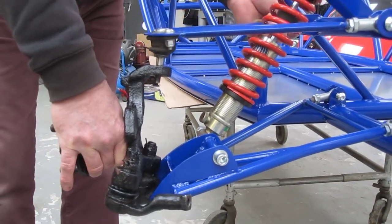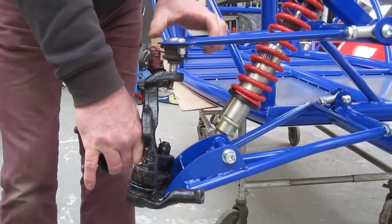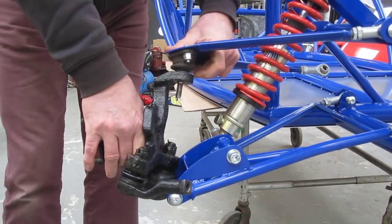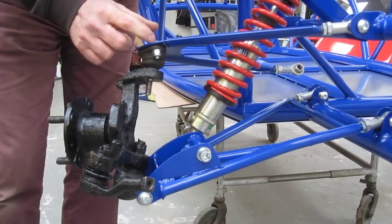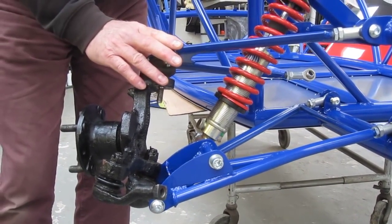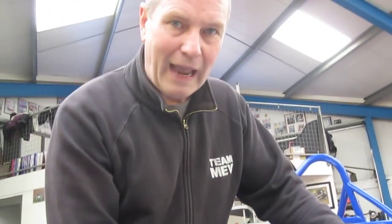So if you've got a similar setup, it's quite easy to rotate the bottom ball joint. If you find that your top ball joint is locking out and it's the transit drag link type, sometimes these can be rotated too. But watch out for caster — too much might create the self-centering you're looking for, but at the risk of the ball joints locking out.